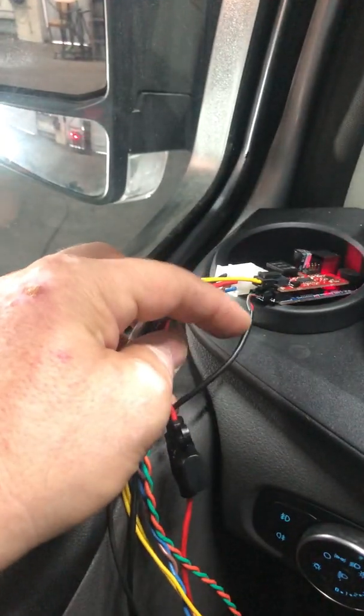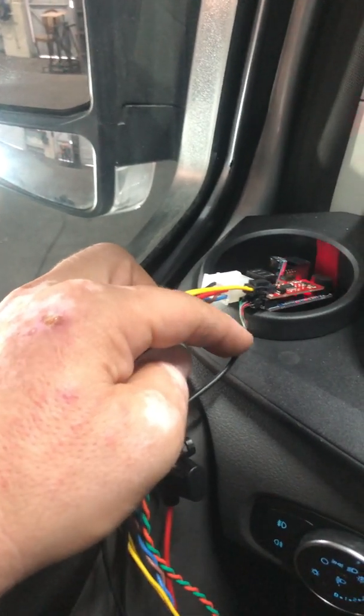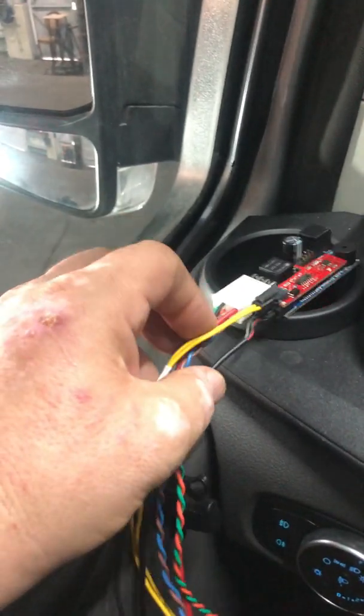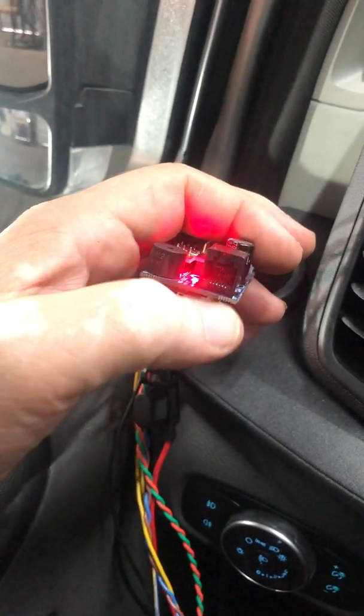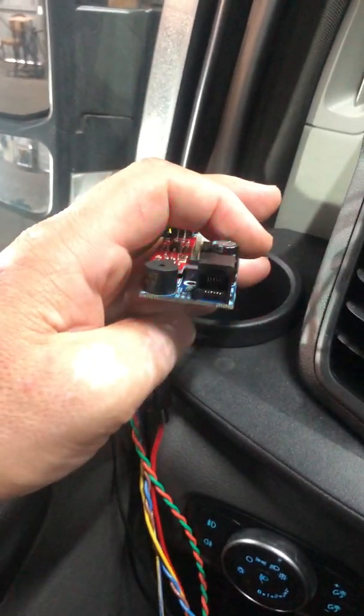So this is our CAN dual LIN gateway. We specialize in this, and I hope we can see some other of our products in some other cars. Of course, this module has a connector here that can go to the input device. You can plug in a joystick, touchpads, low effort switches, and the touch screen, and there is also an input here with an RJ12. You can put five low effort switches, including for the cruise control, like foot switches or whatever. Thank you.